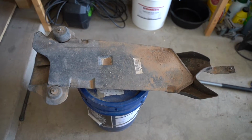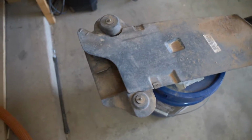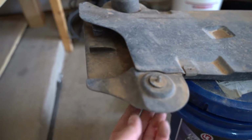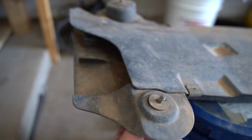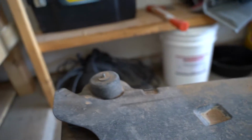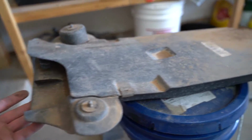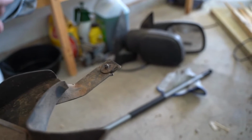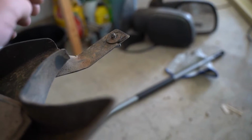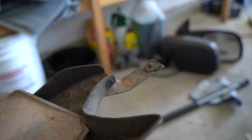I always just move this way off to the side where it's out of my way. So this is the skid plate we just pulled off the vehicle. The 2 ones that we started with are up here. Those are towards the front of the vehicle. There were 2 that we spun counterclockwise on both sides. We're looking at the motor side of this, and then under here is the bottom side. So we're looking at it just as it would sit on the car. When we went behind the passenger side front tire, this is the one that we were working on here. Again, these all go counterclockwise.